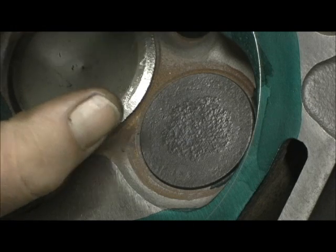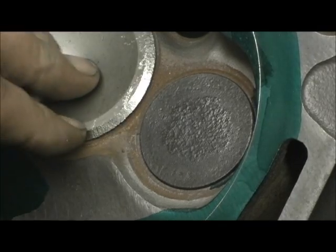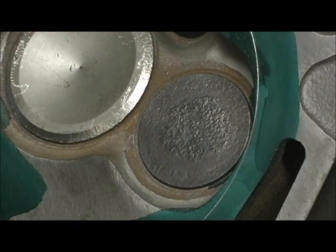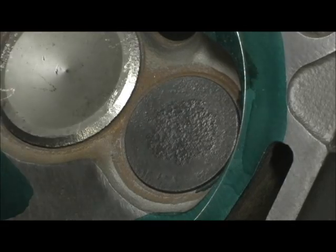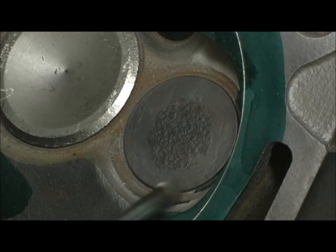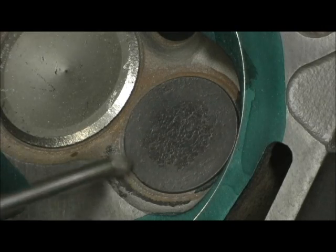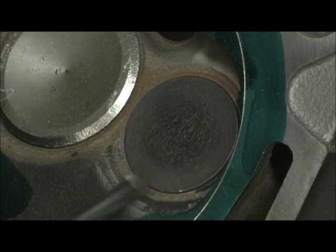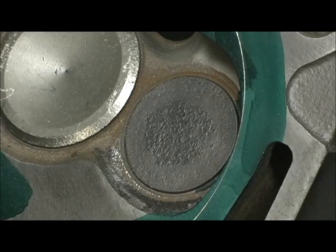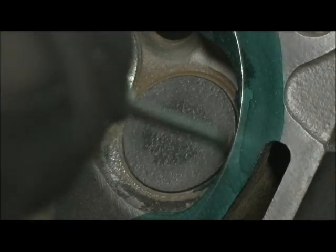To put these gigantic valves — it had like 2.02s and 1.600s in it — I'm going to a 2.15 and 1.65. These are some valves that I cut. Anyway, I'm going to show you how I'm cutting them, how I trim them. You've got to do it so lightly. A good head cutter has one thing he lives off of: no ruffles, no ridges.